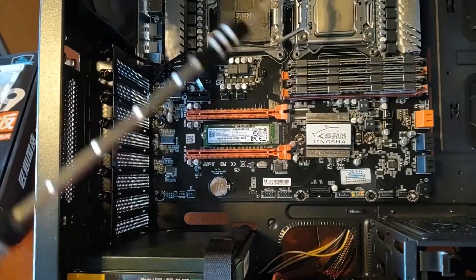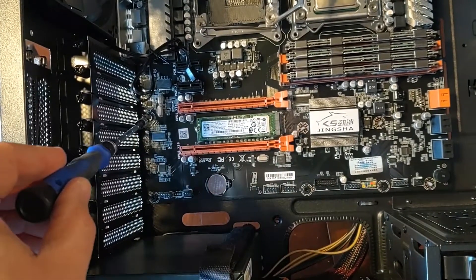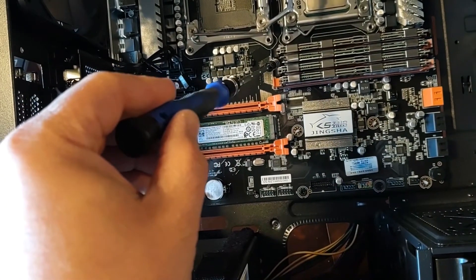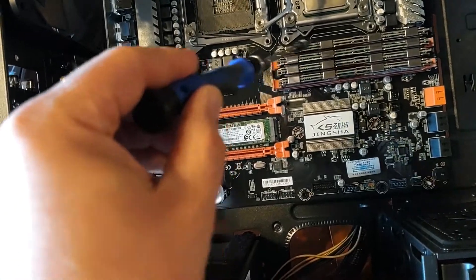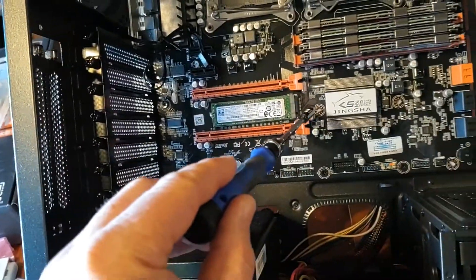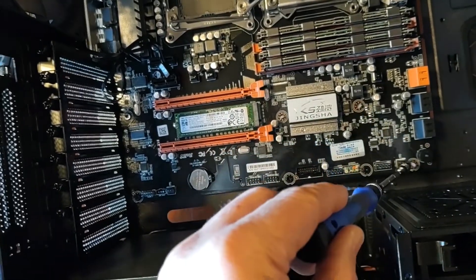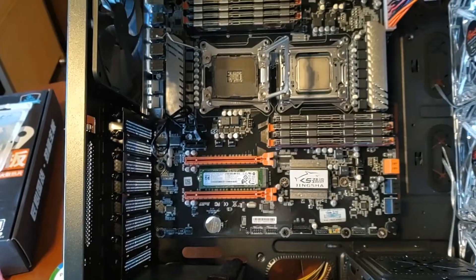Just make sure that the post stands on the back side have a bolt they go into. If you don't move these two post stands right here on the actual case, they're going to touch the back of the memory chips — that's not a good thing. You need to remove those, pull one out, add it over here, and put in the two extra plastic post stands I talked about. Put those in, drop it in, you're good to go.